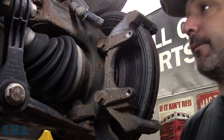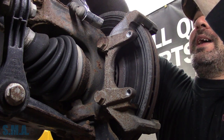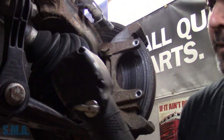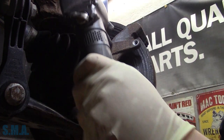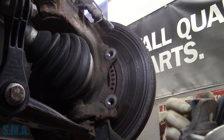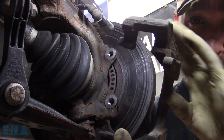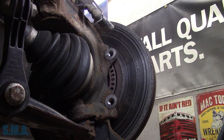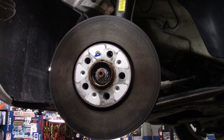Now we're going to pull the bracket off here. Before we do something stupid, let's hang our caliper up out of the way. Take that little fella off. Then I'm going to go sandblast and clean up the spots where the pads ride. No hardware on these — just raw. I'm going to take our rotor off. It uses a Torx bit of sorts — T30.